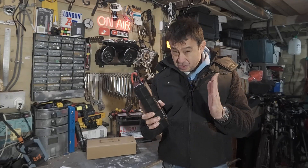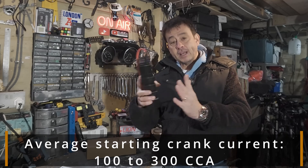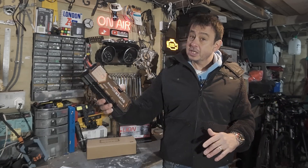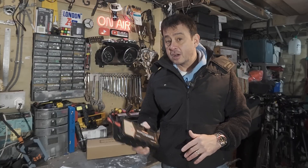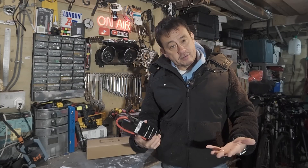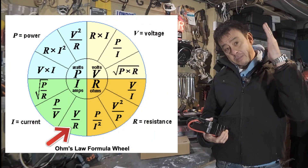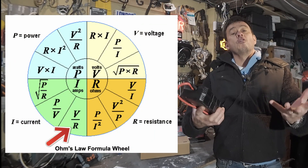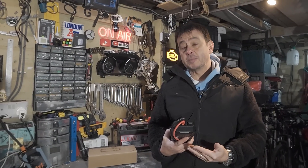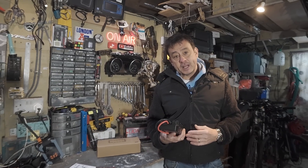Initially when you start your car, it's anything between about 100 amps and 300 cold cranking amps that you need depending on the size of your car. I'm going to show you today on three very different cars just what this is capable of. That initial current — which is basically Ohm's law — is what's drawing that initial power out of your battery. And it takes time to recuperate that energy just lost on initially starting the car.